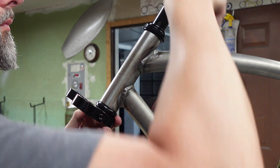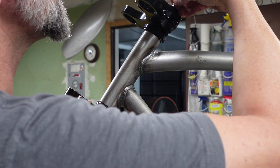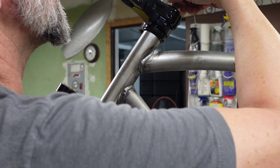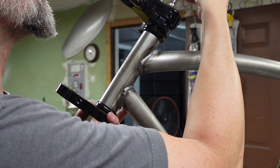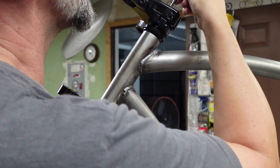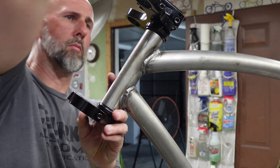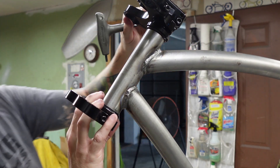Then there's that rubber washer — slide that on and again make sure that the concave on that rubber washer is facing down. Then the main metal washer, which is just there to squeeze everything together without binding that rubber washer. Put the top crown on and then you're going to tighten everything together. Now that you've got the steering neck on and that little Allen key bolt at the top, go ahead and squeeze that together but don't get it excessively tight when you're tightening this down because you'll bind it to where it won't want to spin. You want it to spin nice and loosely but you don't want to feel any play inside of the head tube — it should be nice and floppy.